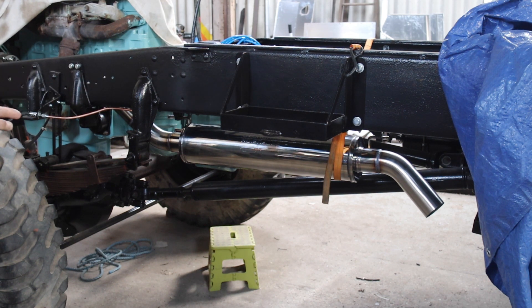The silencer I ended up purchasing in the end — that's about three feet long, six inches in diameter with a 70 mil or three inch bore. I've got some three inch stainless pipe, I was going to make my own, but it's not worth it — it was 101 pounds delivered.